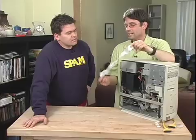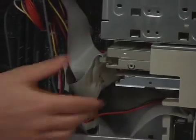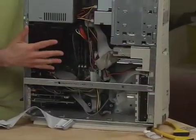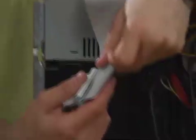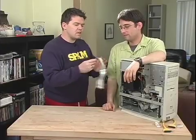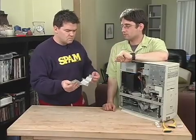So now we've got cables here. This is an IDE cable, and there's a floppy cable in here as well. You notice that these are all just sort of drifting around in behind here, and in a lot of cases they'll be blocking the airflow from front to back. Ideally what you want to do is tuck them away. In some high-performance cases, they've folded them and hidden them around behind other components. You can do that, though it makes me a little wary — you can end up with cable fatigue over time and break the traces inside, and you might start to lose data. But you can do that within a certain tolerance.